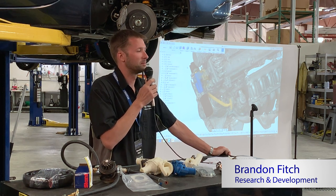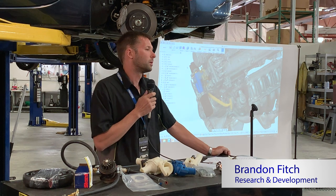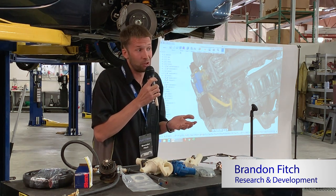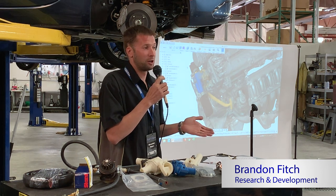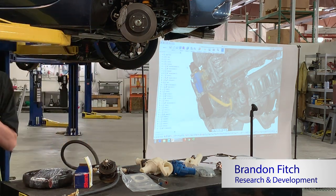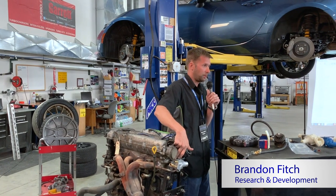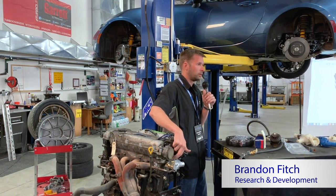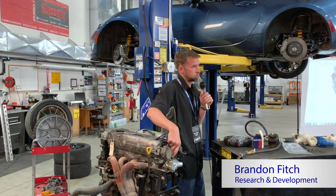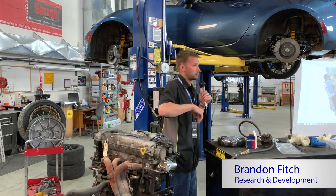Anybody? Is the air bleed you mentioned, is that something unique to the reroute? Would you explain how that works? Sure, so the question is, is the air bleed unique to the reroute, and how does it work? I mean, I guess so. It is on our reroute, and it is not on the stock car, if that answers your question. The way it works is that when you fill up the radiator, the air has to go somewhere, right? And a lot of it comes out of the radiator cap, but if we can get it out right here at the highest point in the engine anyway, then we could just fill it that much faster. Honestly, if you didn't use this on ours, it'd probably be okay. I would suggest using it. But at the very least, it'll make your life much faster. So it'll just kind of expedite filling the system.